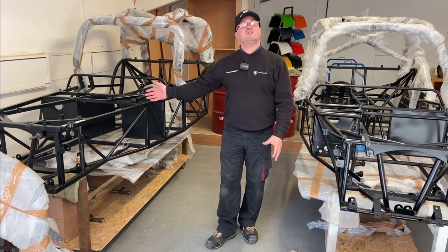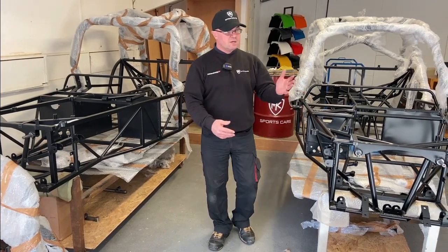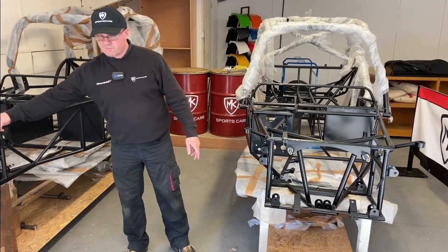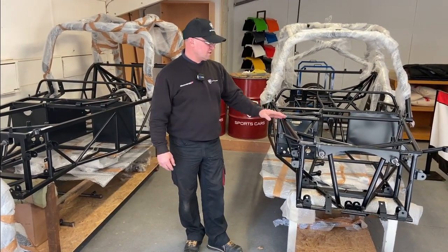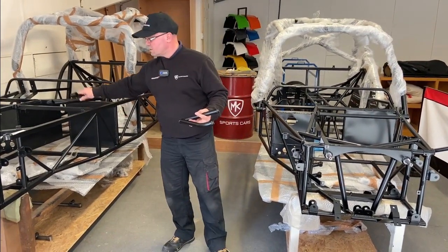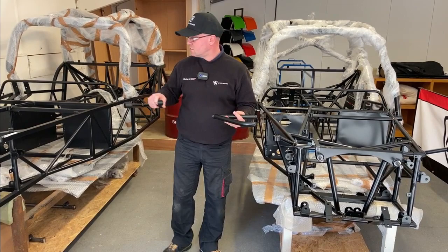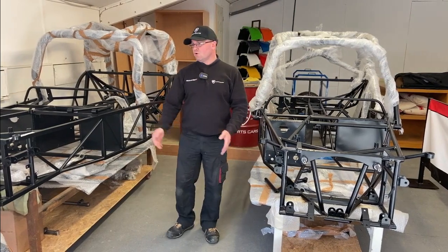The Indy RR costs more than the Indy R — we're talking hundreds of pounds difference. It is a much more labour-intensive chassis to make because every joint has to be butt jointed rather than a square flat finish. The round tube is also a little more expensive to source than square tube. There is also a considerable difference in cost between a £15.99 rose joint versus a poly bush, which simply pushes into the R chassis. Those are the main differentiators — rose joints and shims versus a poly bush and crush tube.